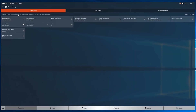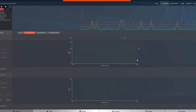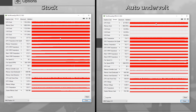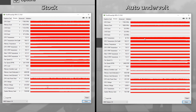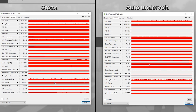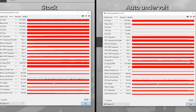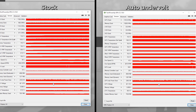Basically, you need a few mouse clicks to get to it and enable it — under Gaming, then Global Settings, then Global Wattman, click the auto-undervolt option, and that's it. Pretty straightforward. I did that right away, which as you can see here in my direct comparison with stock out-of-the-box settings, yielded better results. The core voltage was down by 0.06 volts, which meant the GPU was not getting as hot, which meant the fan speed could go down — and it did, by about 100 to 200 RPM in games, even lower in some synthetic benchmarks. The edge GPU temperature was more or less the same, roaming around 70 degrees Celsius, but the junction temperature was a couple of degrees lower.